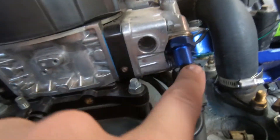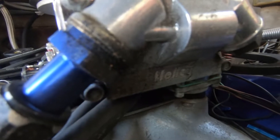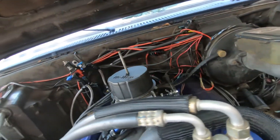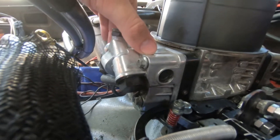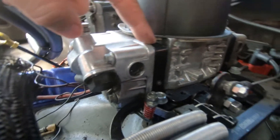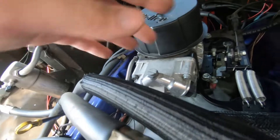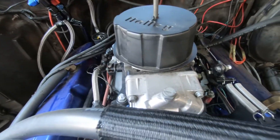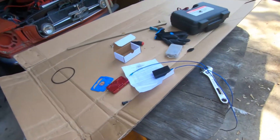After that you're going to be able to leave your fuel inlet hooked up and all you have to do is remove four bolts right there, and then that entire bowl will come off of the carburetor. You'll be able to get to the black part — the metering block. It comes with the carburetor but you have to poke your own hole; that just keeps everything out of it and keeps it as clean as possible. I'm going to pull those out and set this over on the table to show everybody exactly how to make the changes.